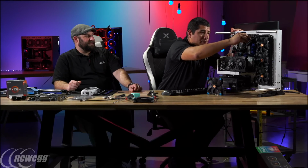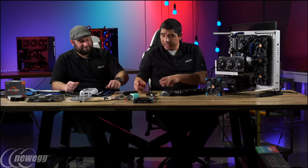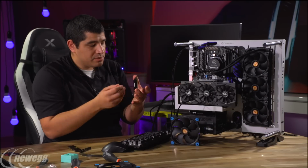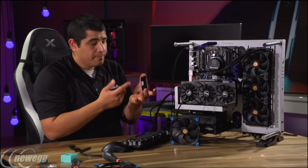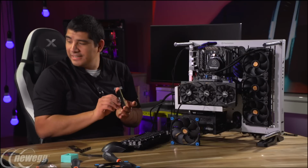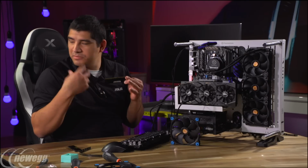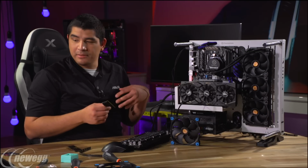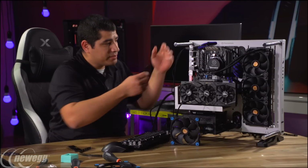One point I will always caution: when you are touching your DIMMs, try not to touch the bottom of the DIMM interfaces. We have found historically that sometimes your oils and minerals, when they make contact with the DIMM interface, can cause initialization issues. So be cautious. When people have DIMMs that are dropping, not initializing, or causing stability problems, we recommend that they clean them, and once they're cleaned, it fixes the problem.